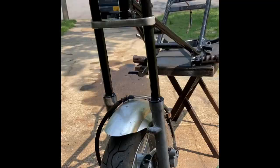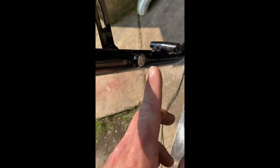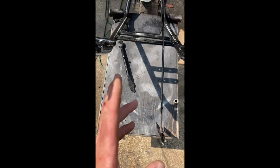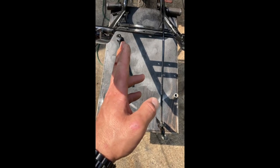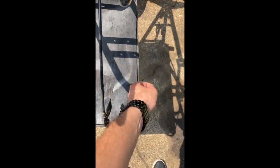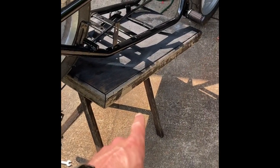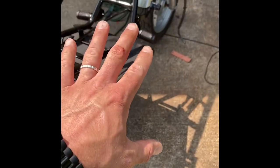I had to trim that piece off because the wheel couldn't go in without hitting the sprocket — it was protruding out about this far. Now I'm going to feed the axle through. You put your spacer on this end, the wheel goes here. I've used the table to my advantage — just let it tip forward and now it holds itself where it needs to stay.